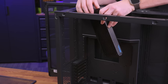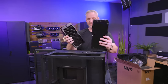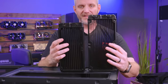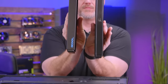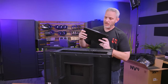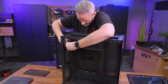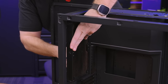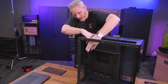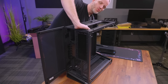I'm curious whether a 280 is going to fit. A 280 is two 140mm fans with all the extra stuff — bigger in every dimension in terms of surface area. Most rads are 30mm, going up to 40mm, 50mm, 60mm, 80mm. The question is whether this is going to fit and still give us room for the ports to clear everything. Okay — yes, you can. Does it line up on the backside? Holy crap — that fits like a glove. I have never done a build where I could have a rear 280 rad.